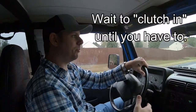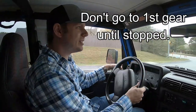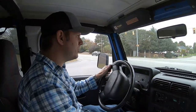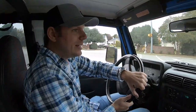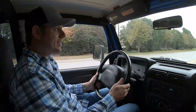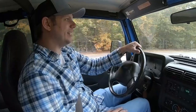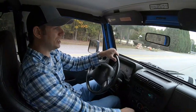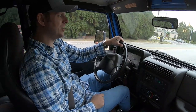In addition to not putting it in neutral, don't hold your foot on the clutch — don't push your clutch in and roll to a stop. You're still burning out your brakes. Downshift to second gear, feel that engine braking, the engine slows down for you. It's the same reason you see those signs in the mountains with the truck on the hill — it's telling you that you're on a hill and you might want to downshift so you don't burn your brakes out. Notice I'm downshifting, barely touching the brake, letting the engine slow the car down.